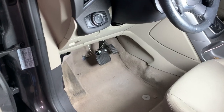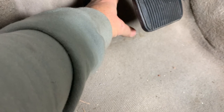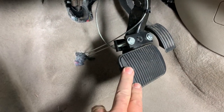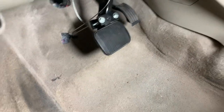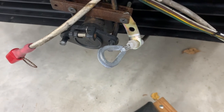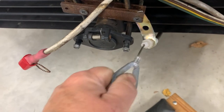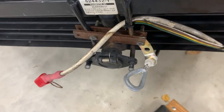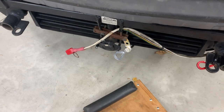Let me show you the inside of the car. Both cables are coming up here — the Ready Brake on the bottom and the Ready Stop on the top. The Ready Stop has the loop they call for, and they're both mounted here using the same plate that came with the Ready Brake itself. I don't have any additional noise or interference when pushing the brake pedal. With the pedal in its normal upright position, the Ready Brake has just a little bit of slack on it — and when I pull it I can hear the pedal inside being pulled. I can pull it out about an inch; I'll have to make adjustments when I hook it up to the hitch to make sure I'm not pulling it too hard.